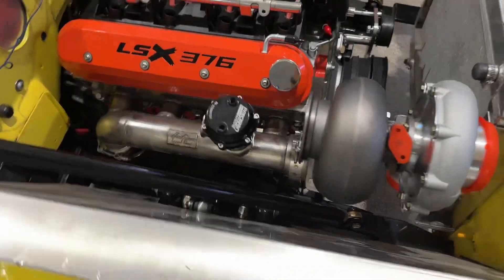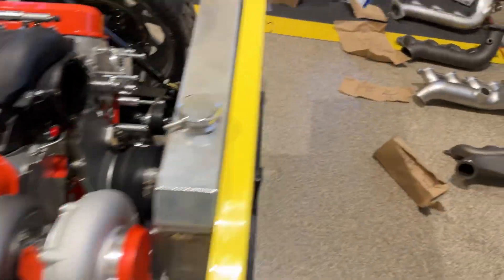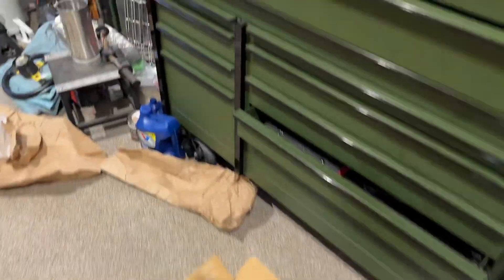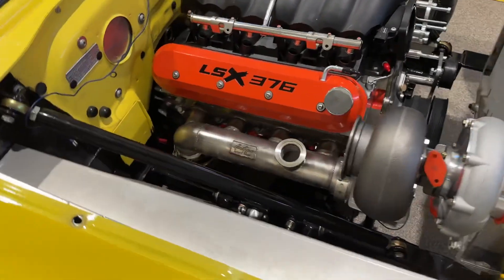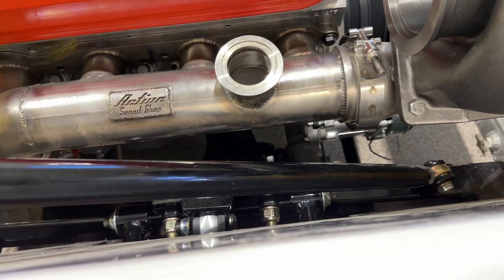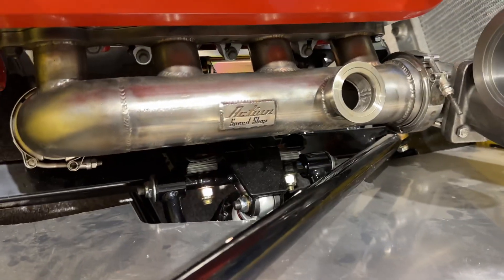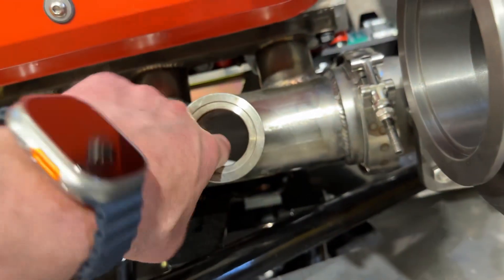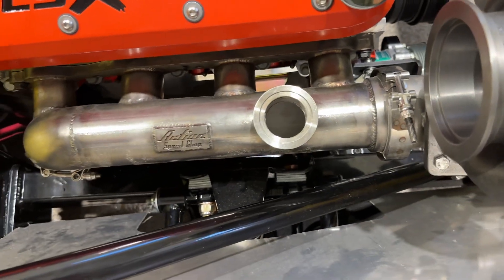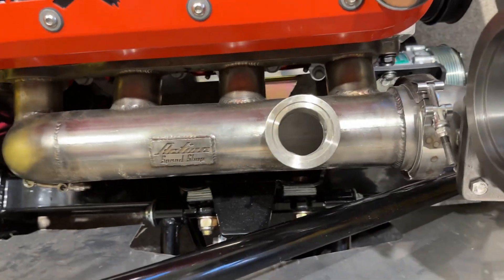One other thing I've learned over the years with turbochargers: wastegates and back pressure can get a little tricky, and controlling turbo speed is something a lot of people don't know about. I've actually had turbos over-boost because of this. A 90-degree wastegate flange is not recommended. What happens is you get all this exhaust gas flowing very fast past this flange — there's nothing stopping the gas from going straight past it. It's like the old water-pipe thing where you can remove a fitting and the water doesn't even come out of the hole on a 90-degree.